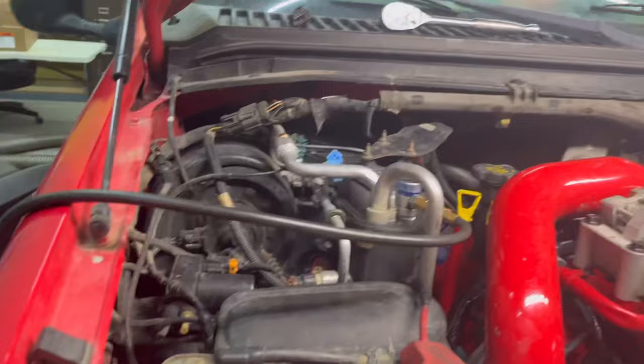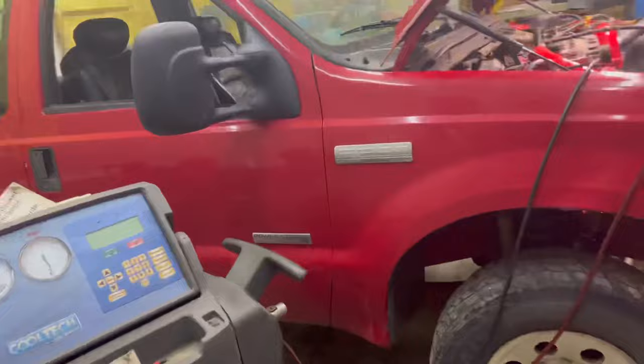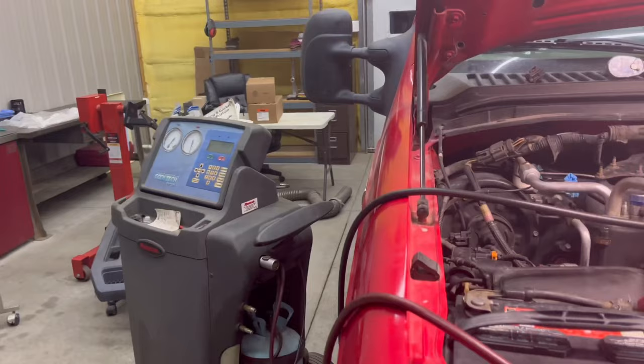I very possibly could just justify going ahead and replacing the compressor again — getting another compressor, another dryer, going ahead and doing the evaporator core and the condenser. It would work then for longer than five minutes. We ran for five minutes and that orifice tube was crap. This refrigerant is expensive now — fairly like $300 some odd dollars for that little bottle — and we lose a little bit every time. But it's not leaking, so that's the bonus. I'm shooting it in and taking it back out, potentially contaminating everything in the whole freaking world.